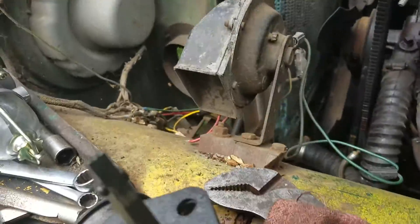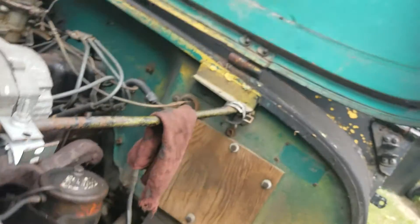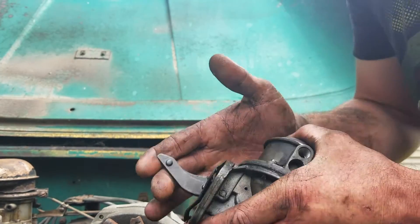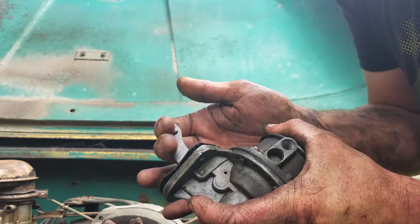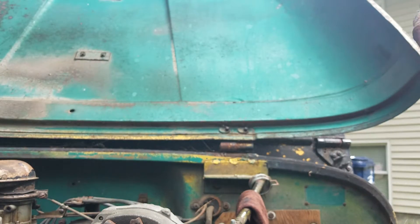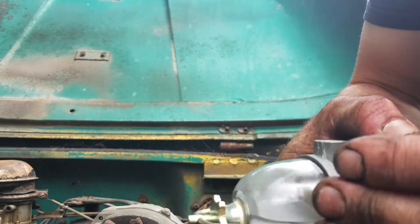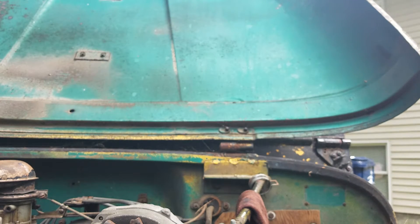As you can see, there's lots and lots of play and no noise on the old pump. There's not even a hard part there — that's the old one, no good. Now the new one — listen — hear that noise? That means the diaphragm inside is actually doing what it's supposed to.